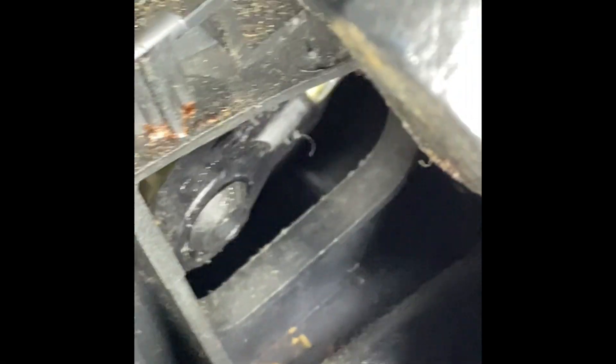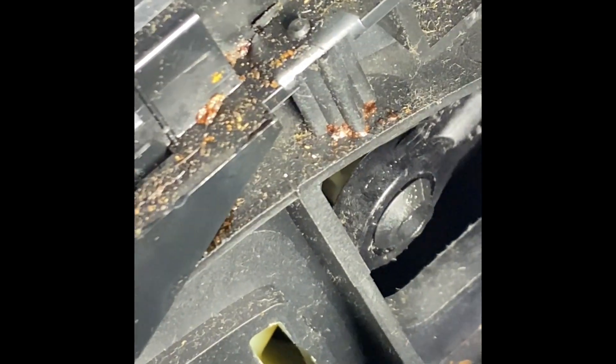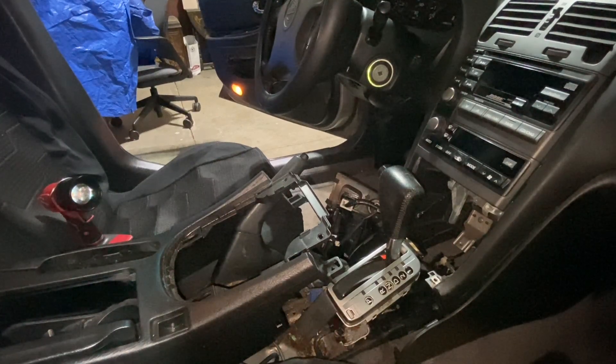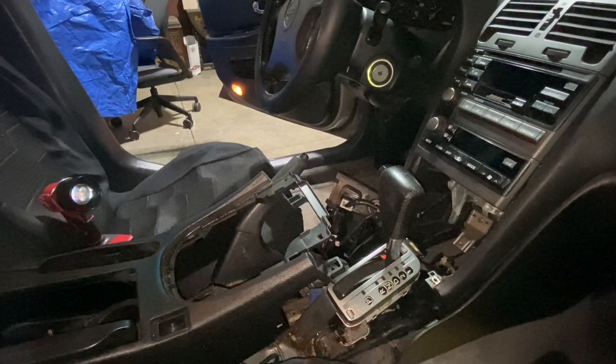You're going to put some grease on it from the supplied packet. I got it on — what I had to do was hold the cable back from behind and push the bushing on with my right hand. Now I have to move the cable back up so I can put it on that little knob there. I was holding it with my left hand up top and pushed in from the side, then slipped it over the little slot. I did lube it up. Now all I've got to do is put all this stuff back.